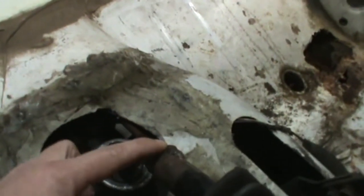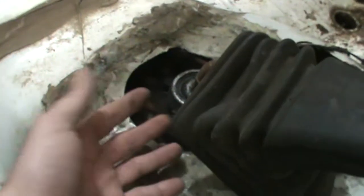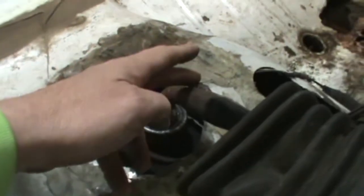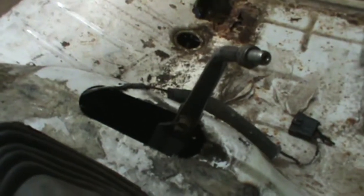And of course the throttle. We'll disconnect that. I think that was a 9/16. There's two bolts out in front of the firewall for that. And then remove the gear shifter here. This has kind of been welded. So instead of trying to take this clip ring out and pulling that out of the transmission, I'm probably just going to grind that off and just take that off. And I believe that's a 14 millimeter or 15 millimeter there for your four-wheel drive. So let's start turning some wrenches.